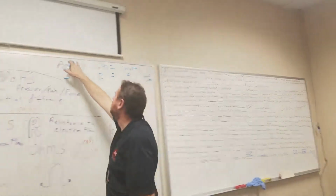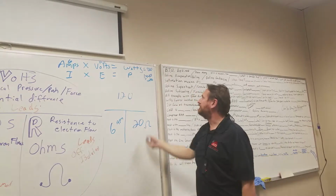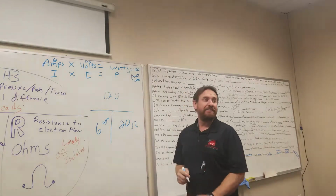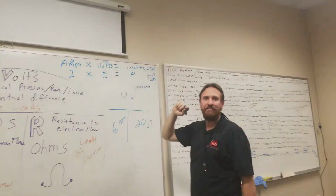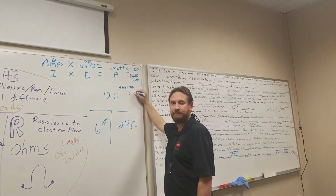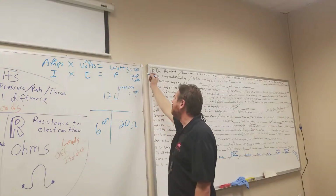That's going to change the number over here. So 6 times 120 equals 720. Wait a minute, I upped the resistance. What did it do to my watts? My watts dropped. And let's convert that to heat. We want heat, right? My original number is 1,440 times 3.413 BTUs for every 1 watt. That gives 4,914 BTUs originally.